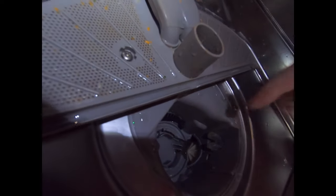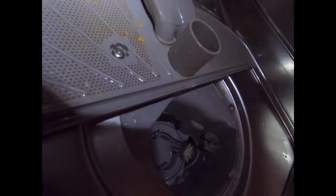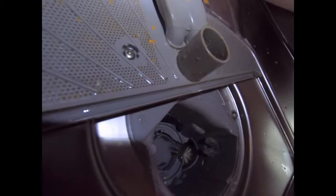You can just see the impeller here. This spins and that's what helps drain the water away. What can happen is if you get any debris in there, that can stop the impeller moving which will stop the whole system draining. So I'm just going to have a feel around, see if I can feel any foreign objects in there — it could be fatty deposits, a bit of glass, a bit of plastic, anything like that that could be blocking it.